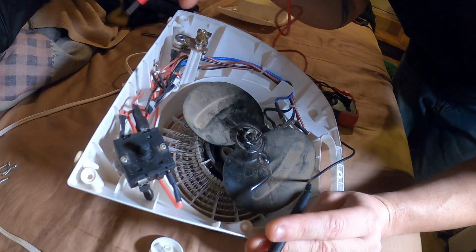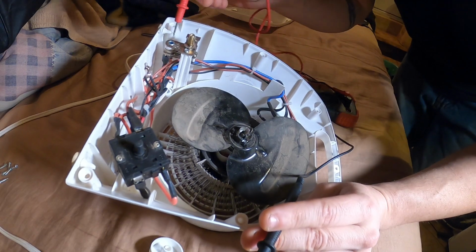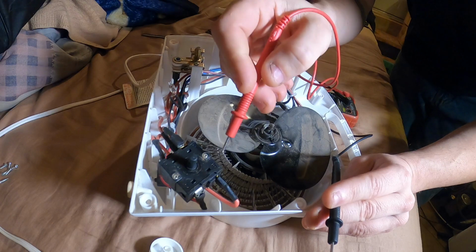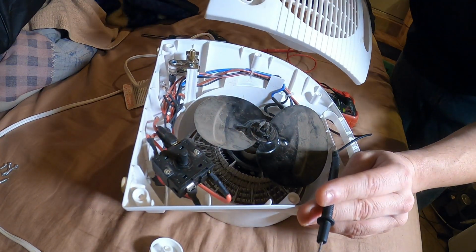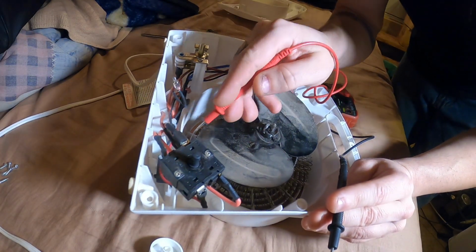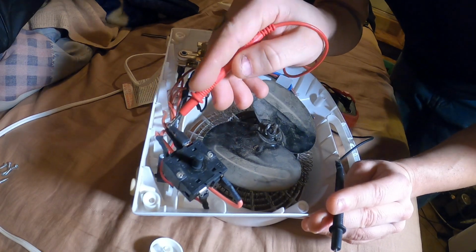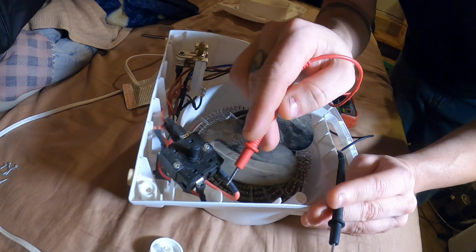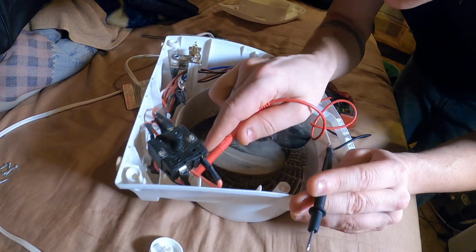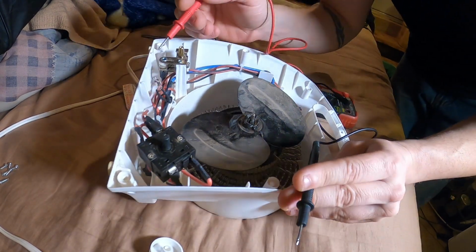So one side of the cord is going to that safety switch, out to the thermostat, out to the selector switch, which will select between medium, low, and high settings, and fan setting with no heat. So power out from thermostat. In, out. It's probably the fan connection. Jumpered over, and this side goes to the fan and heating element.